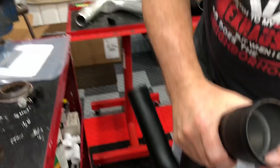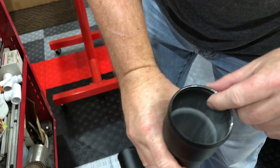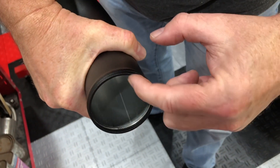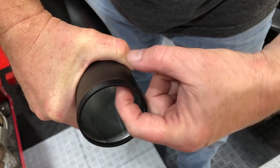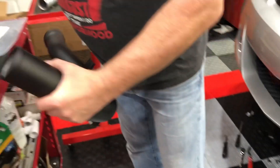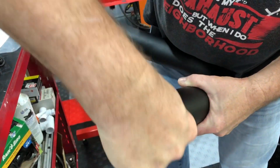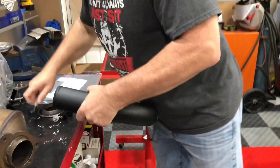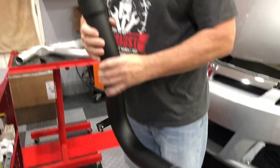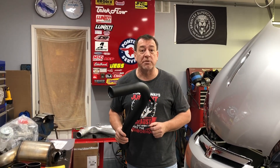There we go — this tube has been nicely deburred. There's no sharp edge left on it and it's not hanging on the inside of the pipe. When you look at this pipe, this inside edge actually hangs in a little bit more than the inner surface — probably fine, but I like the idea of deburring it just to make sure it's not protruding inside. It was that fast to do and it just cleans off that inside edge. That's it for tips on the charge tubes for today. I'll come back as I start to install these in the intercooler in a future episode — thanks for watching!